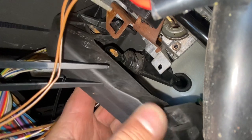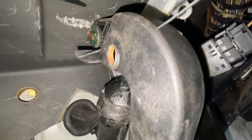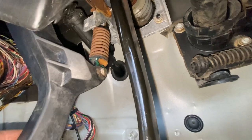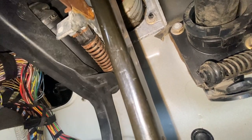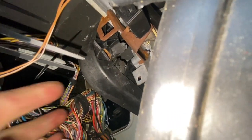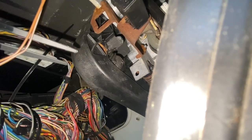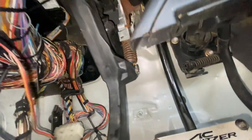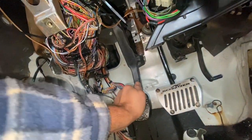I'm going to put that pin in and lock it on the other side to attach the master cylinder. Okay, I put everything in — just pushing on it and she's in. I'm going to put the pin in and lock it on the other side for the master cylinder. The clutch is installed — we put all the clips on, everything's attached, and it works.